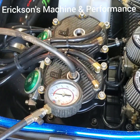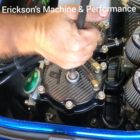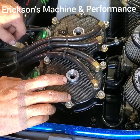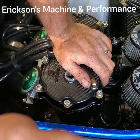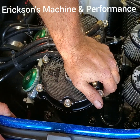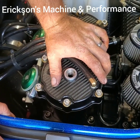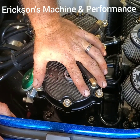Now this is showing one thing that's really common. This is a fresh motor with zero hours on it, so a lot of people would see this and be scared — it's actually nothing to be scared of. Before the rings seat, the compression can vary greatly. It could be the amount of oil in the holes. You could see 30, 40, 50 pounds compression difference on a high-performance motor. It doesn't really say anything. I normally don't personally check compression until there's at least a tank to two tanks of gas run through it, because at that point the rings have set and it's going to give you an honest compression reading.